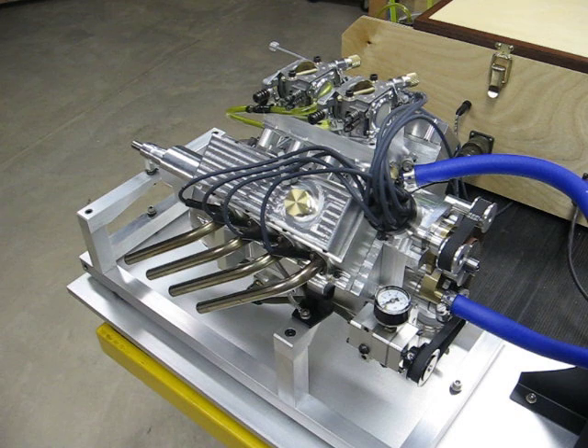I am old school so I like my ignition systems with distributor and points. I used a standard ignition coil, capacitor, and points that I fabricated myself using tungsten contacts. I added a simple circuit to limit spark width to 300 microseconds to eliminate some point float. The result was a very hot spark with capability at 10,000 RPM.